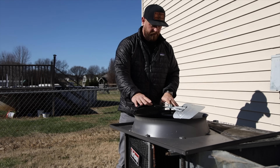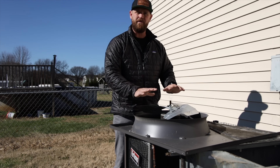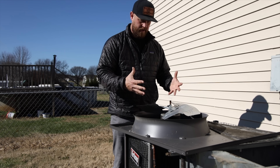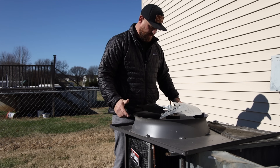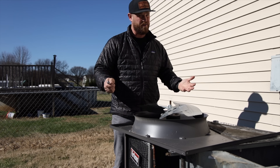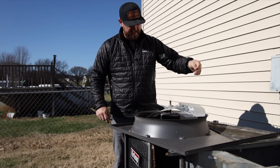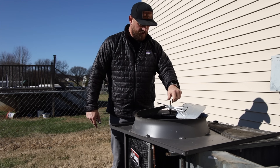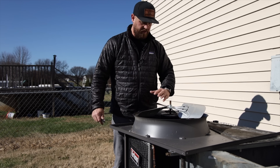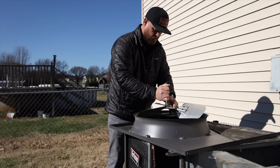What I'd like to do before removing the actual motor from the top plate or housing is remove the fan blade first, because with it being on something much bigger, it's going to help me keep everything in place while I go to remove the fan blade. Sometimes they come off super easy and it's not a big deal, but sometimes it's super hard and you have to get a puller. This unit's not super old and doesn't have a lot of rust, so I don't think I'll need any penetrant or a puller — I'm just going to loosen this set screw and wiggle it off.